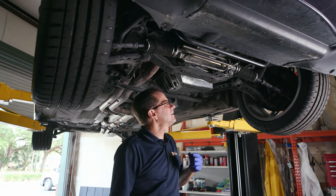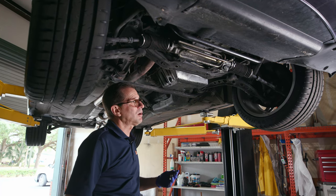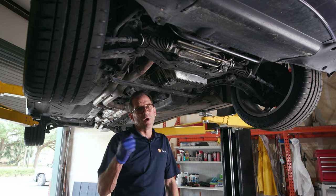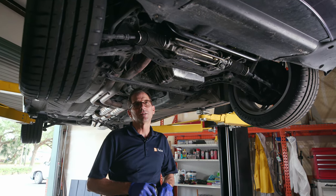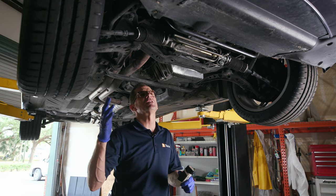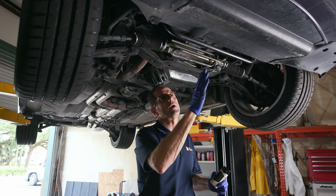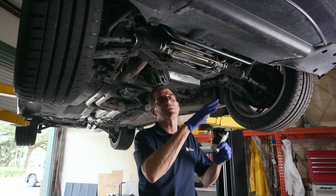We got to watch a lot of the things that you typically wouldn't have to worry about. And then once you've done some cars, you know what to watch out for and how to minimize the risk. But it's not like wave the wand like a pressure washer and you're done and anybody can do it. It's artistic. It's almost like reverse painting. So you'll see me make a pass and I'll flip the gun and flip it at the end, because if you concentrate in one point too long, you're going to make an impression on that or clean that differently than the rest of it.